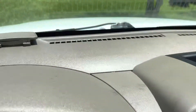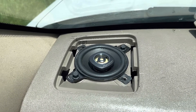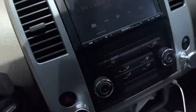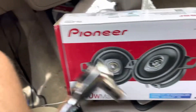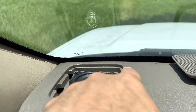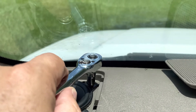I've already installed this one over here and it is a perfect fit. This one only takes the two bolts. The Nissan only uses three bolts to put theirs in, but there are two bolts here and those are a 7mm. You can use the socket wrench for the front speaker bolt right there. The one in the back you will not be able to — it's pretty tight, so I just used a 7mm wrench on that.